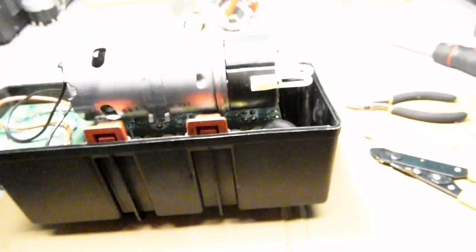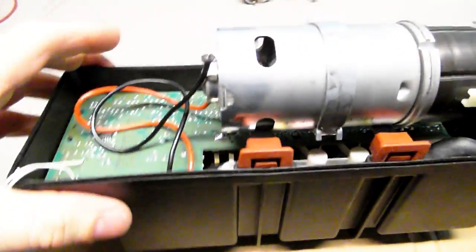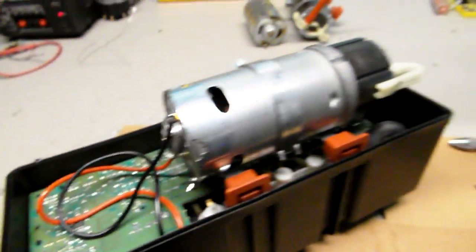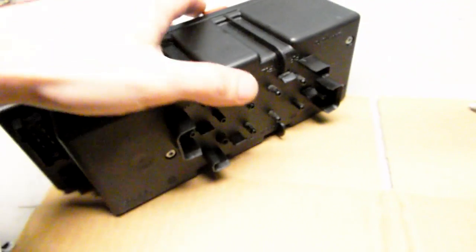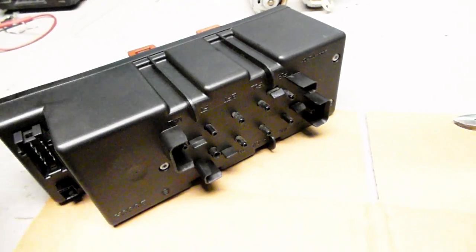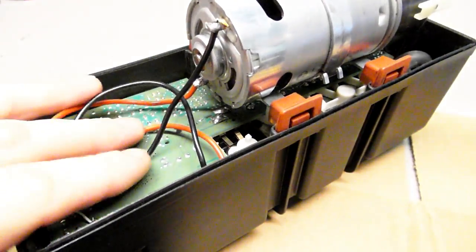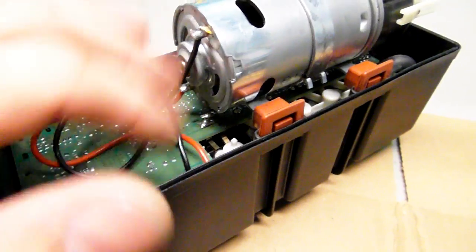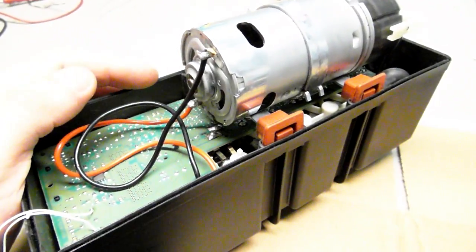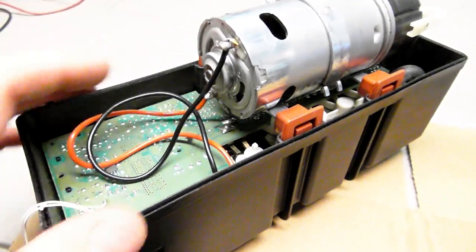The problem is the vacuum leak in the system. Vacuum or pressure leak, one or the other. There's something going on. That's why the pump was replaced originally. So that has to be looked at. But so far, it feels back pressure, and the current consumption tells the controller here that the motor consumes more power and it just shuts down, because it feels like it did its job. It's time to shut off because it feels like it's pumping air pointlessly.